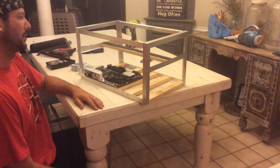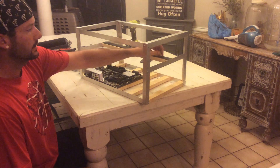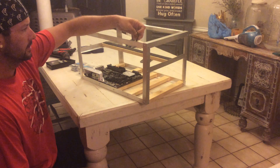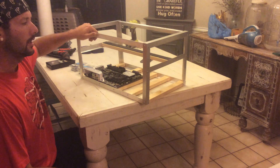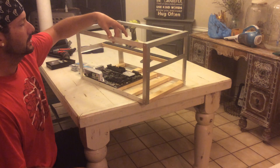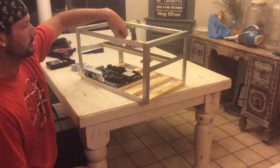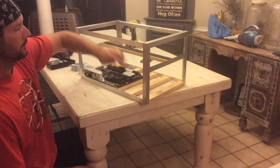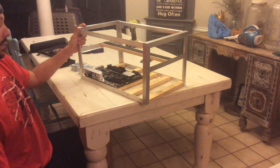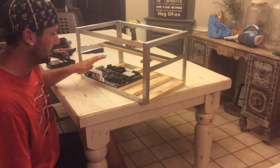I pre-drilled the holes for the metal screws to go through. I did add a little bit of this rubber matting — the kind you put your tools on so they don't slip — for the base and the video card bracket. I plan on screwing the video cards down, so I put a bunch of holes on this front lip. The L-bracket is facing the cards, so the lip goes here and the base of the card sits here, screwing down rather than being flush.